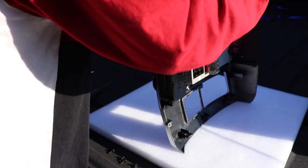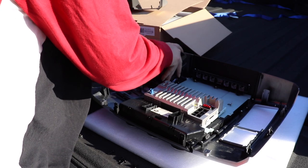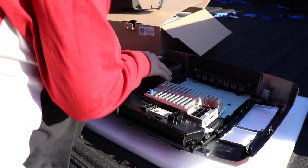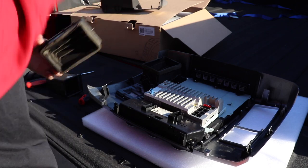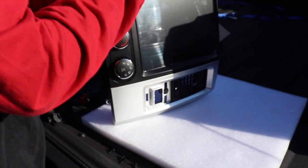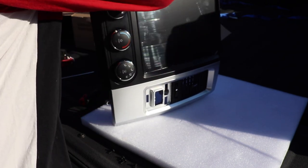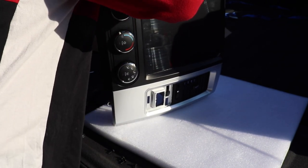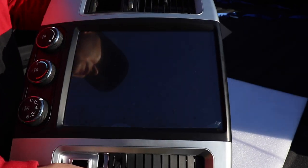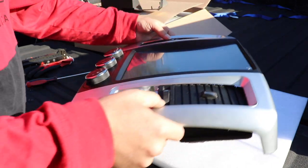The vents and cubby hole just push and click in — you just have to make sure you're working on the right side. Now, put the cubby hole in first on this side, or your four-by-four selector, whichever you have. From experience, the way to install on this Phoenix bezel is to install the bottom one and this top one at the same time. Otherwise, they end up pinching each other and they don't line up smoothly where they meet, so you want to mount these at the same time together.